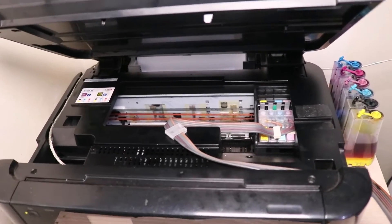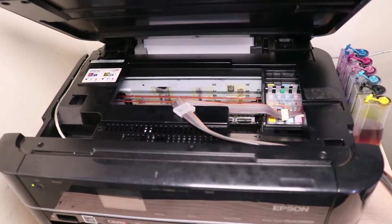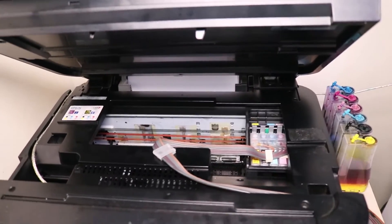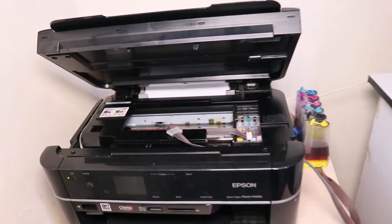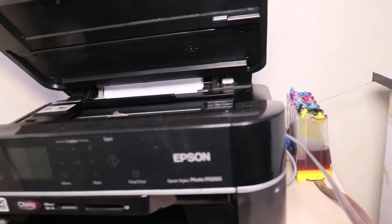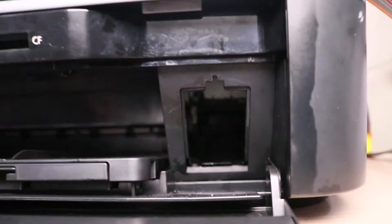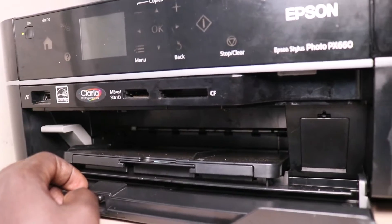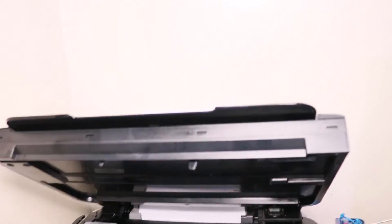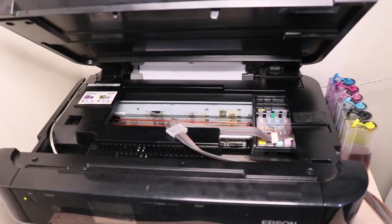Before I called the technician, I just looked inside. There was a lot of ink that had poured down inside the printer. When the technician came and opened the printer, he told me that the issue was caused by the ink overflowing. The Epson PX660 has waste ink that is released, and from the factory, there is a tank inside which has to be emptied regularly. That tank was full and was pouring all the extra ink into the rest of the printer, making the printer sense a paper jam when there was none. There was a lot of waste ink inside, and it had affected the whole printer and had to be cleaned.